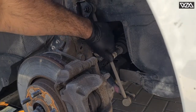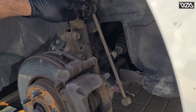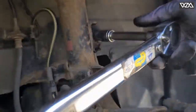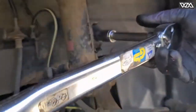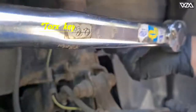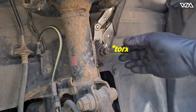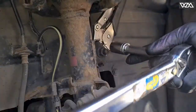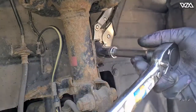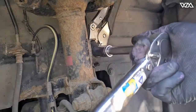I've just used the WD-40 spray here and we're going to open this bolt here and the one behind. This is a 17 millimeter bolt. The upper nut is loose but I can see it's moving from behind as well, so I will need to use the spanner and the Allen key to open it. If you do not have an Allen key available, you can also use a clamp plier in the back to hold the inside bolt and then try to open the nut. Now it's loose.